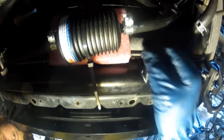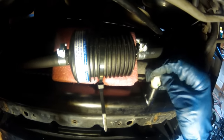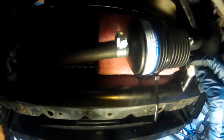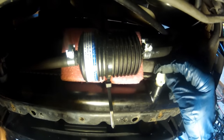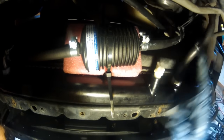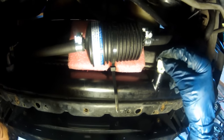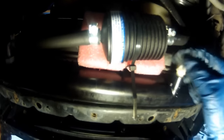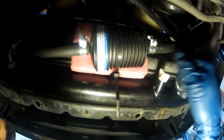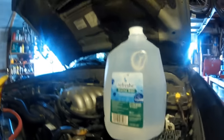The drain is right here — just lefty loosey and open it up until it starts draining. Don't back it out all the way, because then the fluid won't flow down toward your catch container — it'll shoot straight out and make a big mess. Just back it out enough to get a nice flow. Once drained, remember to close it — tighten it finger tight — just like when you change your oil and put the drain plug back in.